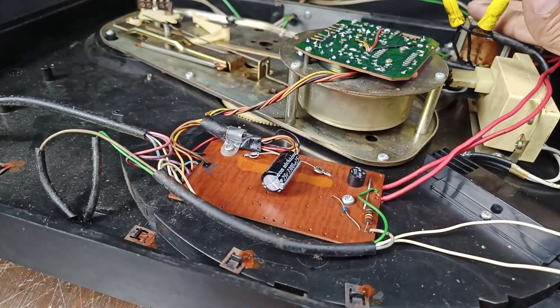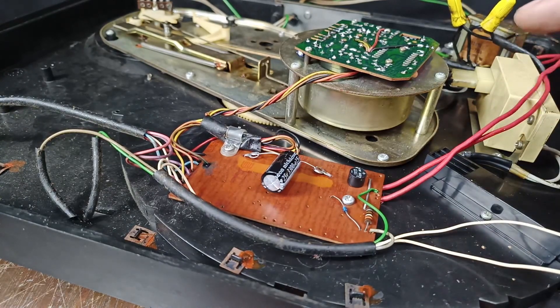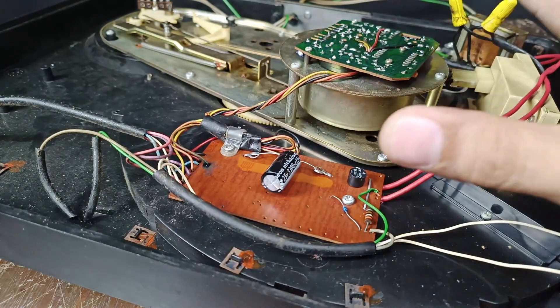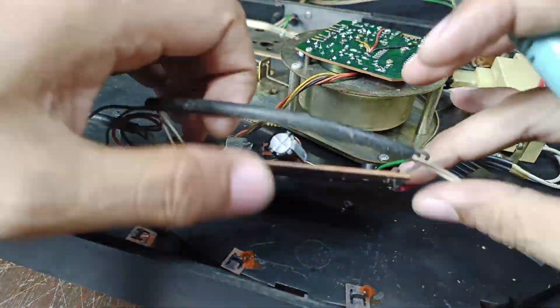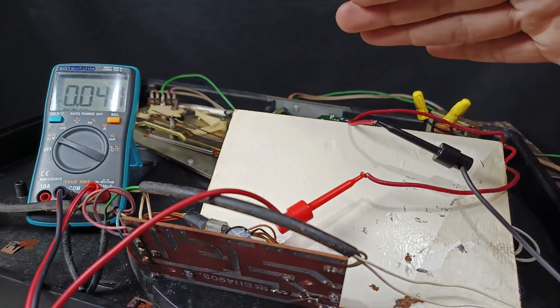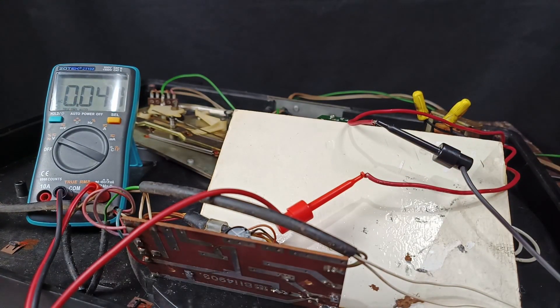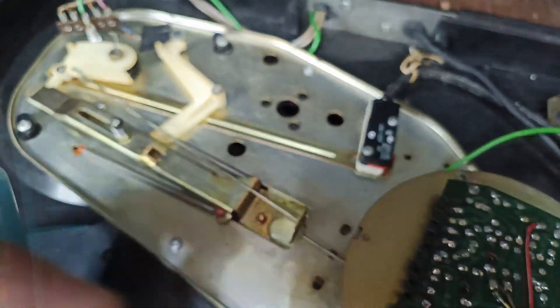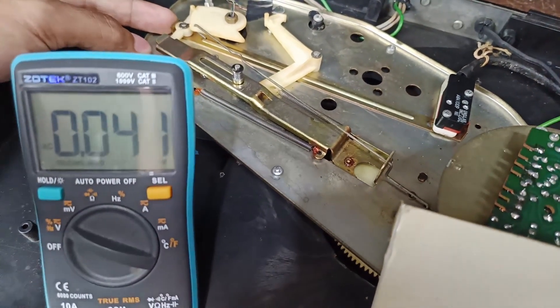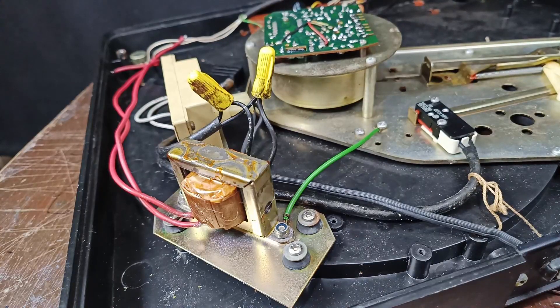From this point it has a red wire that connects to this circuit, and these two red wires are secondary. Before replacing the power transformer, let's check the output voltage first. I'll isolate these two red wires from the rest of the circuit. This turntable is plugged into 110 volts — it has a switch connected to the tone arm that must be turned on. I'll push this part and check the output voltage — it reads 16 volts.